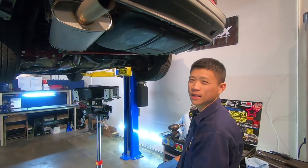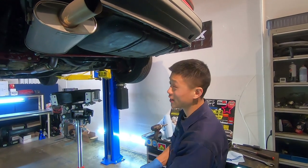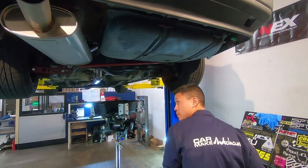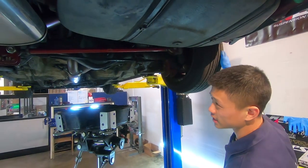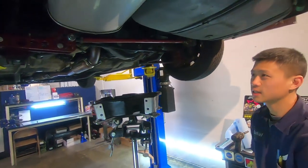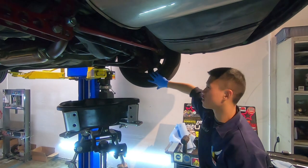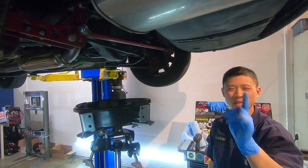All right. It's a momentous day. We're gonna finally fill gear oil in this thing. Yes, it's been quite the long day. Tip for you guys filling up gear oil in this thing: if you can find a friend, one guy turns the wheel while you fill, you can put more oil in there. Oh, I didn't know that. Yeah, that's cool. And if you notice, you can tell there's a good LSD because you can't turn the wheel the other way now. Oh, yeah. Both of them turn the same way. All right, we're gonna fill gear oil and come back.